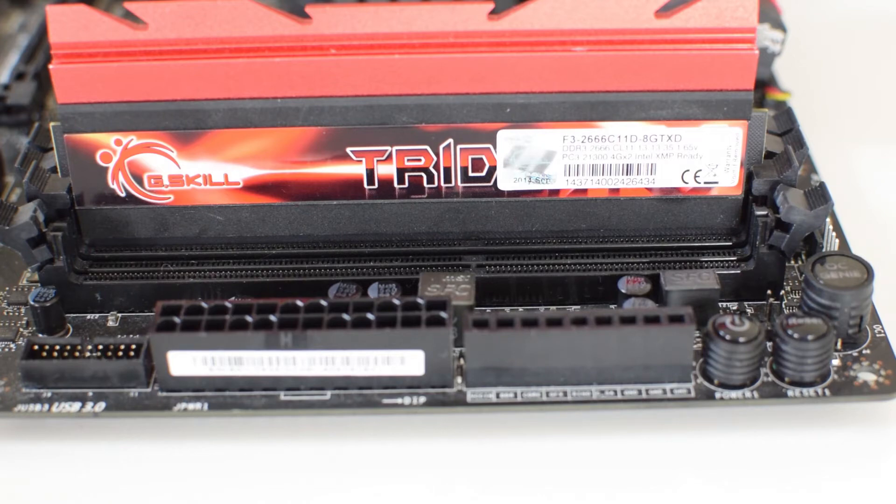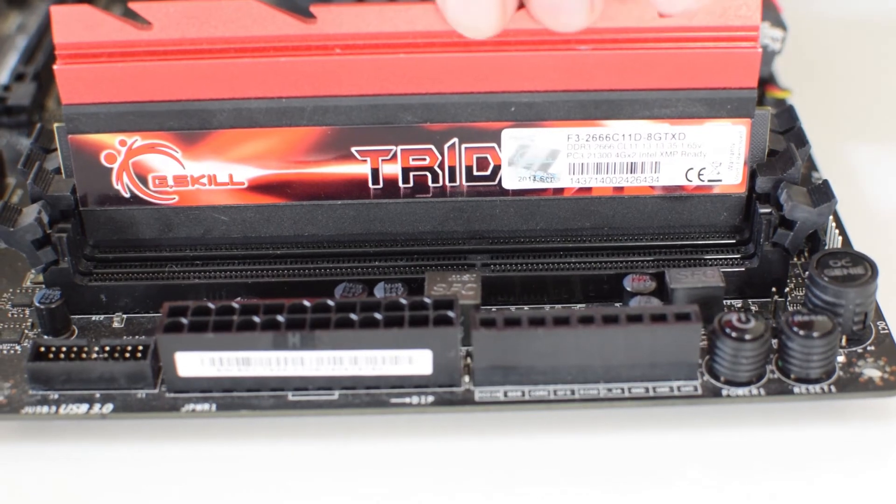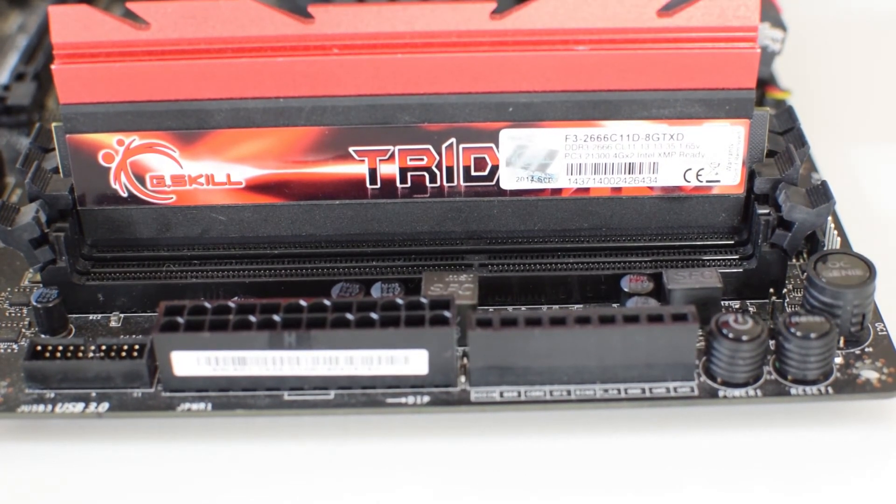It's really that simple — just locate the cutout on the pins on the RAM module, pop it into the socket, and push it down until it clips into place. That RAM is now installed. That was an installation of DDR3 RAM — it's really easy to do. If you have any questions or need any help just give us a shout. Please like, comment, and subscribe — it shows support. Thank you for watching.